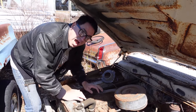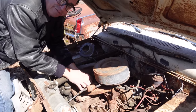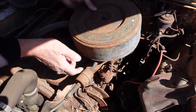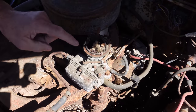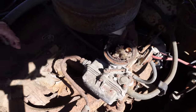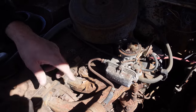With the slanted engine design, it also allowed for a longer, more streamlined intake manifold — if the engine were upright, there'd be less room for a streamlined manifold. This is the Ram Tune intake manifold. It runs a one-barrel carburetor; there were no two-barrels in the States, though Australia had them and two-barrel slant sixes appeared in the late 70s here.